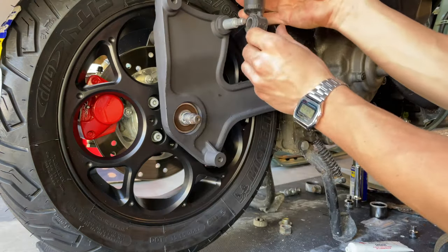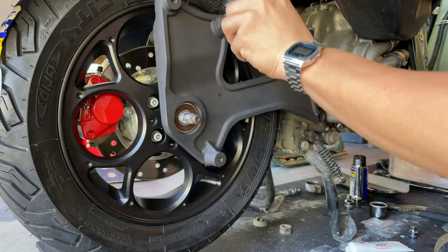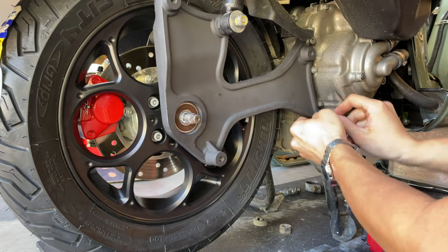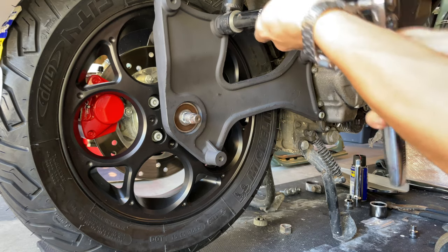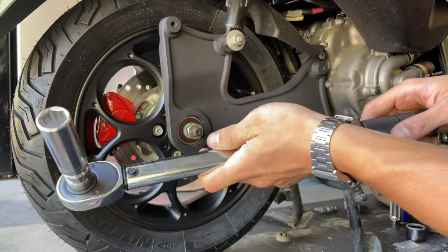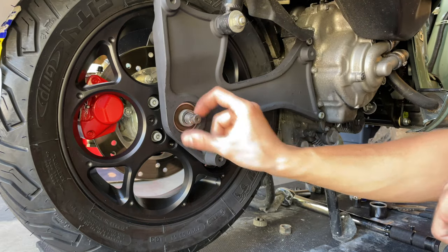Get the shock starter here. This is the nut for the shock — and there. 17 millimeter. We have a torque range; the shock is around 30 foot-pounds. We're meant to put that washer in there.